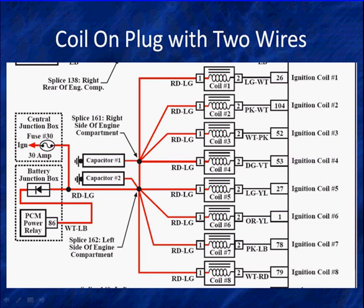We're going to say this one time. When we say check B+, if this voltage is not right, the coil is not going to have full output. You may have something no more complicated than a charging system problem, reducing voltage to the coil. Pay attention to things like battery voltage. We have to say that because we get into this advanced diagnostics, and sometimes we forget the simple things.